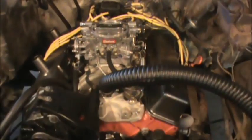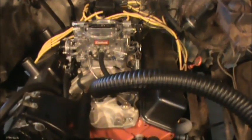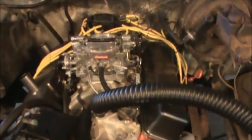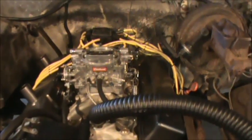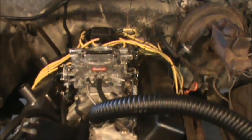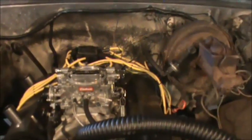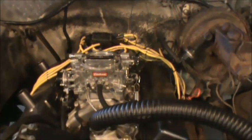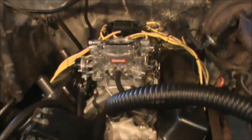So we've given you a brief description of what exactly ignition timing is, what it can do to create horsepower, and where it needs to be adjusted. We're going to move over to the engine and explain a couple of things we need to do, then go into actually doing the process. Here we have my small block Chevy 350. I freshened it up just before winter — I've done away with the cast-iron intake and the Quadrajet carburetor, went with an aluminum Torker intake with a 1-inch spacer and a 625 CFM Edelbrock Performer Series carburetor, and went with some 8-millimeter plug wires.